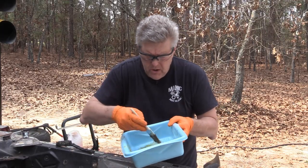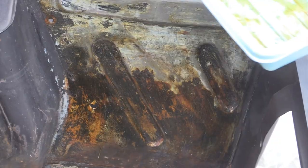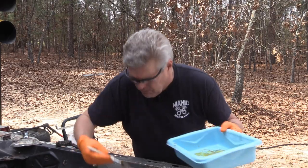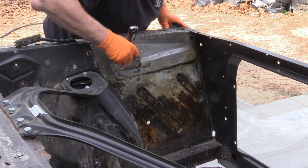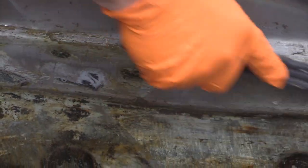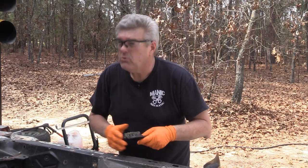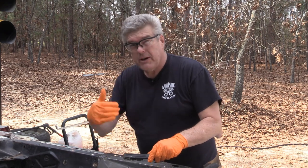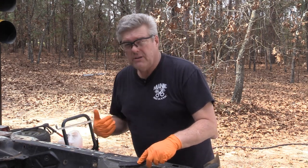It'll work better if you apply the stripper just to the edge and then mechanically go in with 80 or 220-grit sandpaper against those edges. This is a laborious process, folks — this is not a 15-minute job. You're going to be at this a pretty good while. Don't wear nice clothes. If I were doing this on an outside surface like the outside of a fender, I would buy a Tyvek suit from the home improvement center, put it on, and just shell it when done.